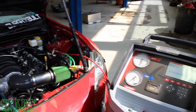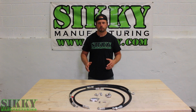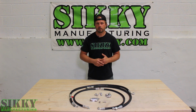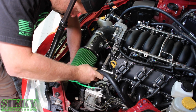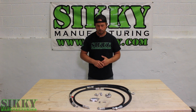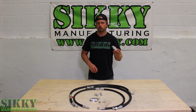Based on our testing, we recommend a 1 pound 6 ounce charge in this system. It can vary a little bit depending on your setup, but we've found it to work best with that particular charge. Be sure to check out our other YouTube video, the step-by-step installation of this complete system, to learn more about how simple and easy we make this install. To make the install even easier, I would recommend installing this firewall block before you put the engine into the car.